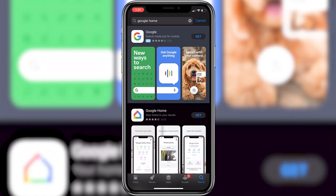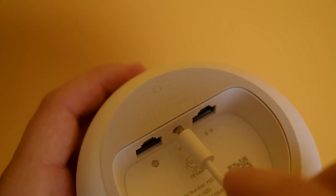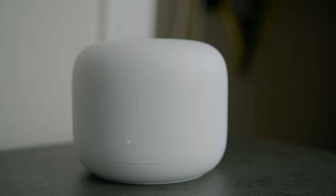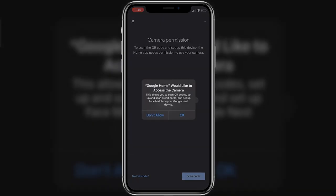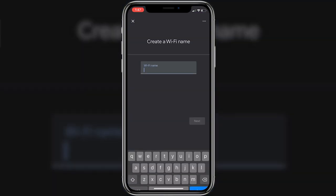For starters, Google gives you a very easy setup process. You need to download the Google Home app to your phone or tablet, where you can follow the instructions for a breakdown on how to set up your Google Nest Wi-Fi. You'll plug in and power on your Nest router, then plug it into your modem with the included Ethernet cord. After about a minute, the router should start to pulse white. In the Google Home app, hit the Add button in the top left, then hit Setup Device. From that point, just follow the instructions on the app until you're asked to scan the QR code, which is located at the bottom of the router.